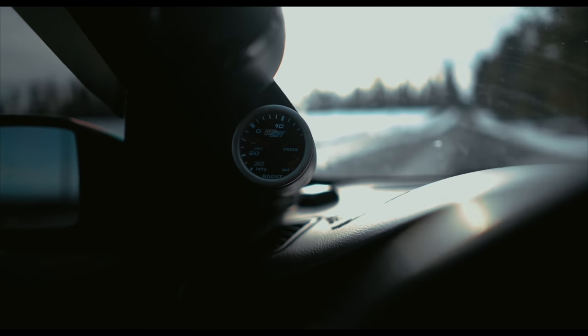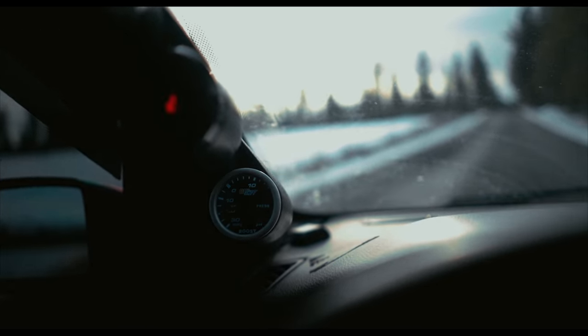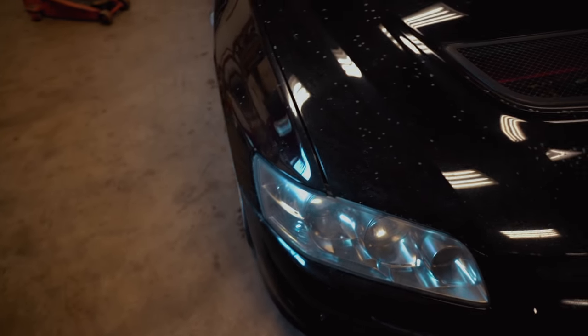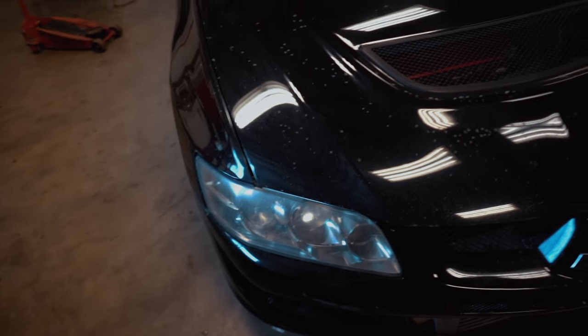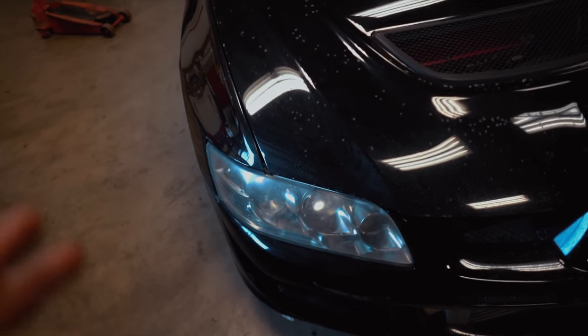The 3,000 to 5,000 pull was a little bit over 30 psi, steady at about 32 psi. I sent Mark at Apex over the log and everything looked fine — AFRs were good, check engine light wasn't flashing. All good to go.